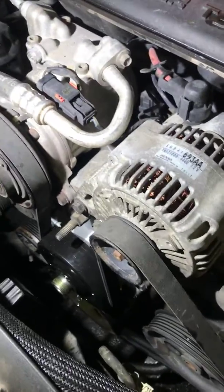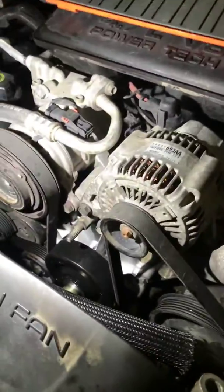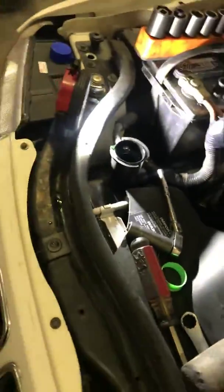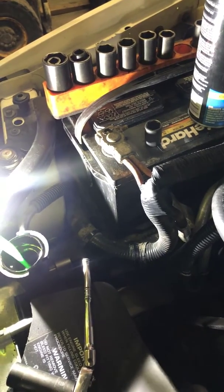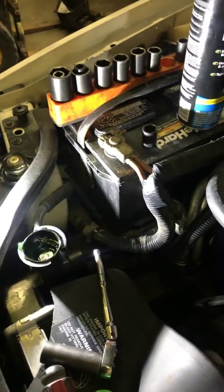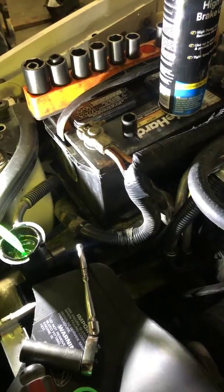After the pump's in, put the belt on. I didn't even have to drain the radiator, so my radiator pretty much stayed full. What was in the top part of the block went down. And let's see. Let me finish putting some coolant in here so we can get an exact measurement. Obviously, I'm going to run this and let it run and see where we go. I think the way I did it without having to drain the radiator, I'm going to end up using less than a gallon. A whole lot did not come out.